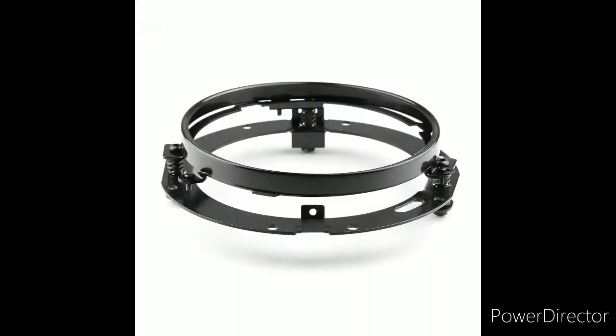Okay, so you need to get one of these 7-inch headlight brackets, or actually 2 of them, and notice that it has like 3 adjusters at 12, 9, and 3 o'clock. Those are how you're going to put them on the car too. I'll leave a link in the description on where to get these, but in the next image I'll show you how to orient it on the vehicle.